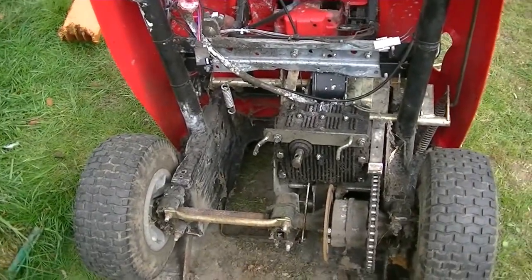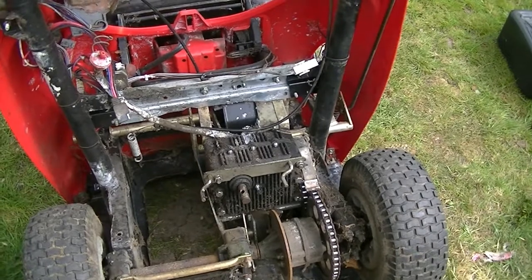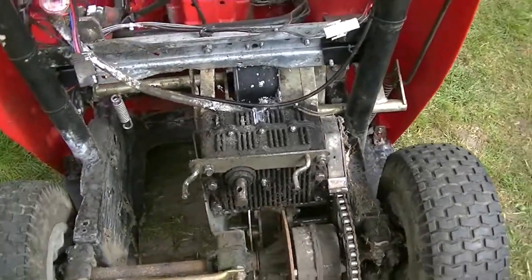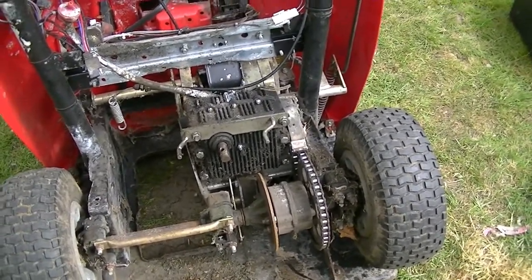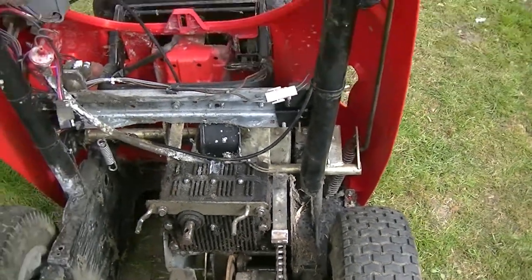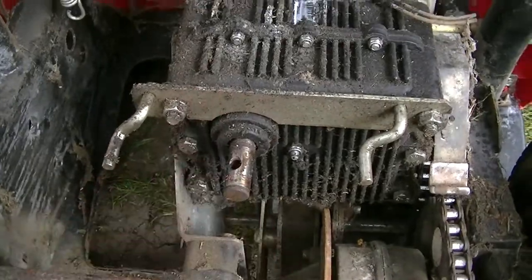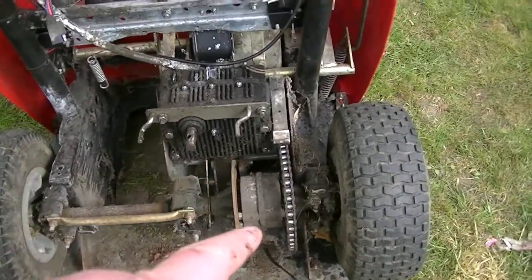Think of the options we could do with it. I've always said about this gearbox and axle to keep — I've been talking about it. I'm guessing the internals of that gearbox are plastic — not the cogs, you know, the sprockets and stuff. The front sprocket is plastic, and there's a lovely big sprocket on the back — plastic. It's done what it needs to do, it still works. The tension on the chain is just this little springy bit of metal. The pulley for that is plastic. All the mounts, the bushes — one, two, three of them — they're all plastic, not rubber.